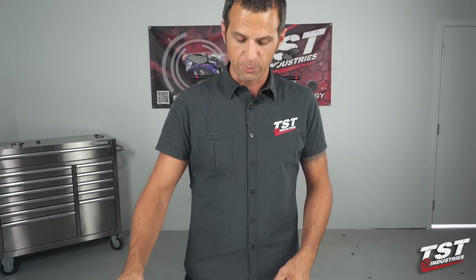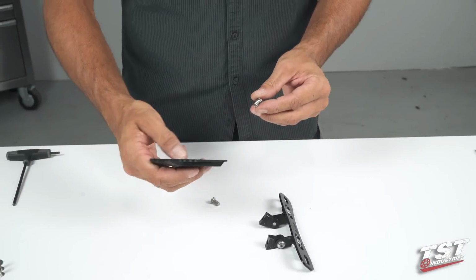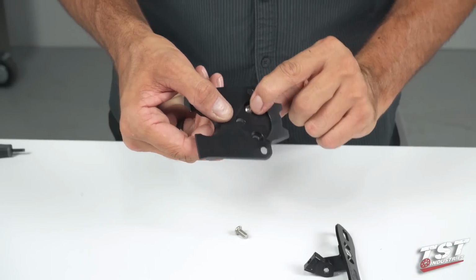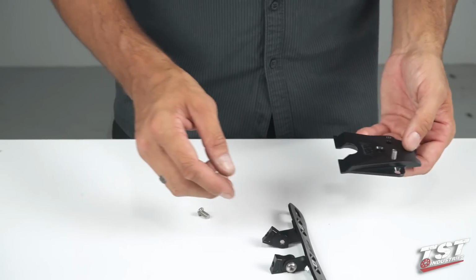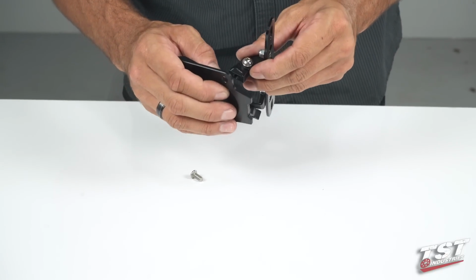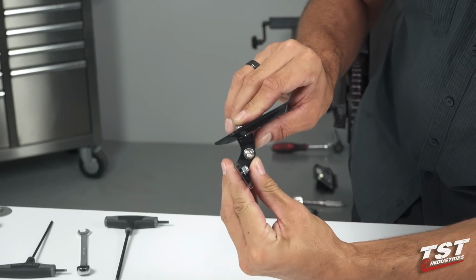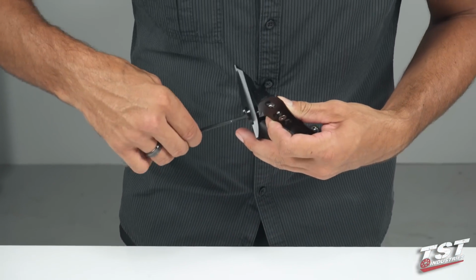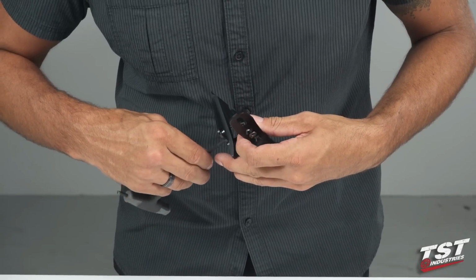All right, so now let's grab the remaining smaller screws. There are 2 of them, and insert them into these pockets, these bores on the non-cosmetic side of your closeout, and then arrange these components in a way that make the system end up looking like this, using a 4mm Allen. Turn those screws in, make sure to leave some adjustability.